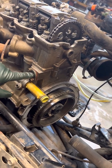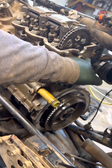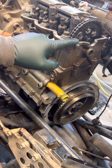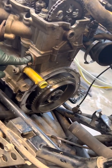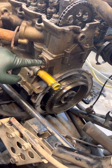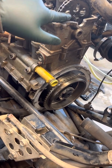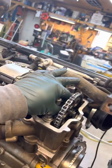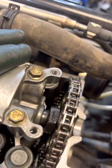I learned that when you're setting the timing on this, when you set this mark you actually want it to be down over here, because then when you push your timing chain in it'll bring it back around so that both marks line up. This tensioner has a fair amount of force — it's a hydraulic tensioner but it's also spring loaded. If you push your finger in there you can judge by where it is, and you're going to need a wrench or a pair of pliers — this is a 32 millimeter hex head on the camshaft.